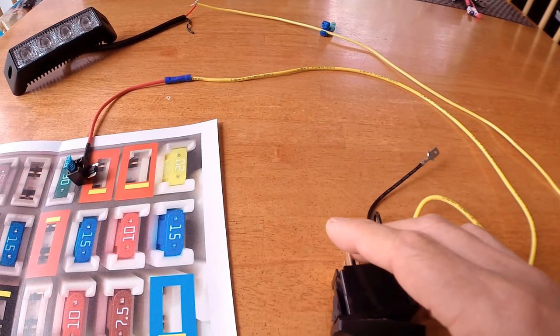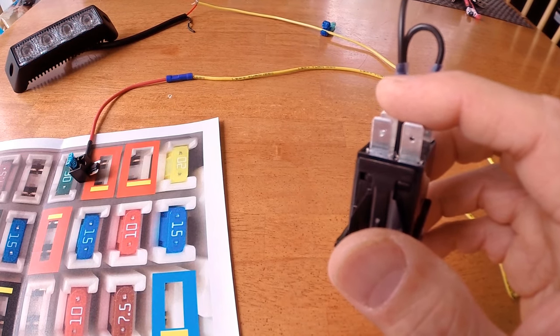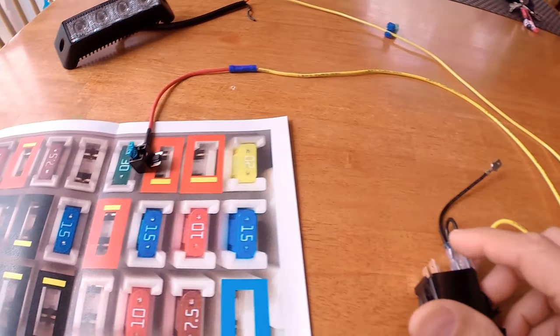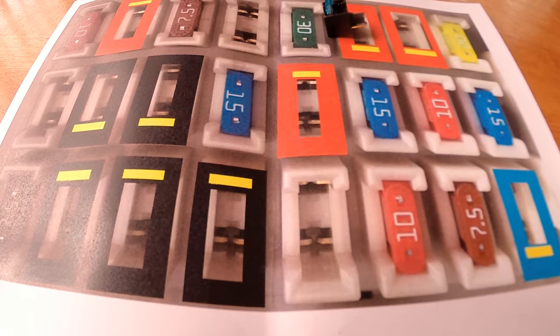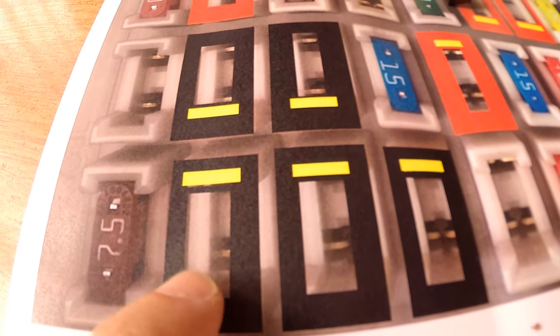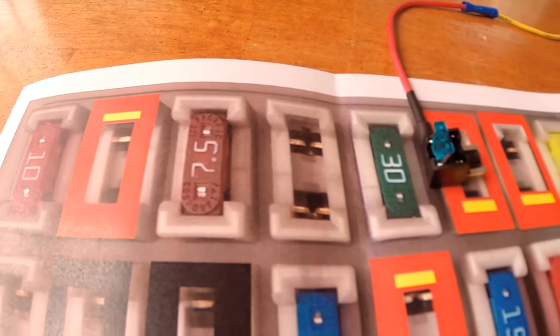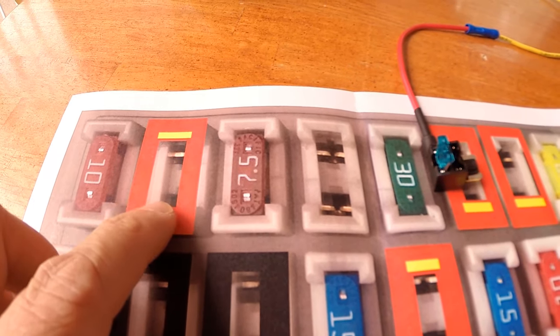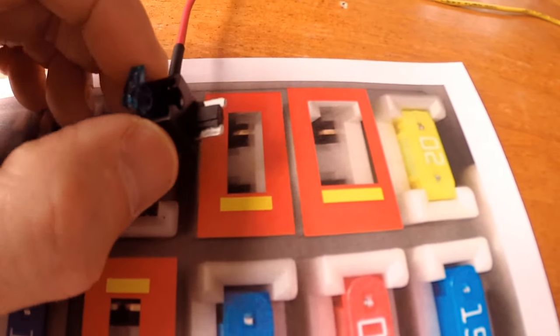And the way to wire that, the power source, remember I told you it's in the middle right here, really needs to come in from either the battery, or, the beauty of the FJ, the fuse block on the left-hand side, driver's side, just about knee high. I've marked a few things in here. The black with yellow are always hot, and the yellow right here represents where it's always hot; this is in, and this is out, the part of the fuse insert or slot. The red ones are hot when your ignition is on, and again, in and out.